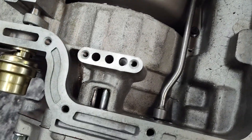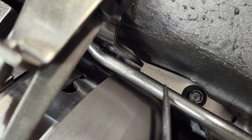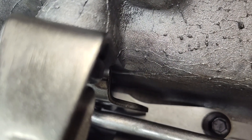Now this one — this is most common. I'm going to try to show down in here. If you see this, it's a flat spring and it's got a roller on the end of it. And then this is like a rooster comb — it's got little notches for the roller to ride in. And that's what positions the shift arm and in turn positions the manual select lever on the valve body. So this is 1972 and up — detent in case. This is most common.